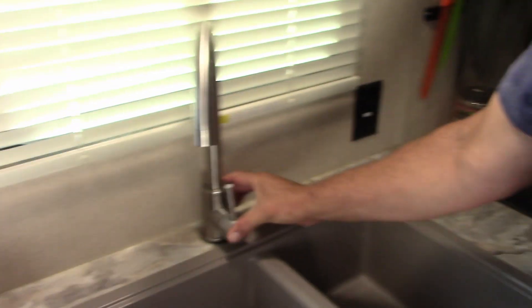So let's take a look — the faucet is not moving where it's not supposed to, and it's moving where it's supposed to. I took a little bit of silicone underneath and put it on the threads, so when I threaded it up it's gonna act like what they call a nylock nut to help keep it from loosening up while traveling down the road or with any vibrations. Alright, so if you liked the video please hit that like button, subscribe, share the video. Until the next time we meet, happy camping, see you soon, bye!